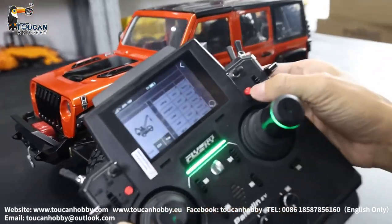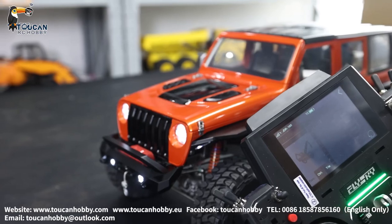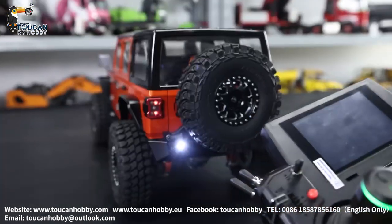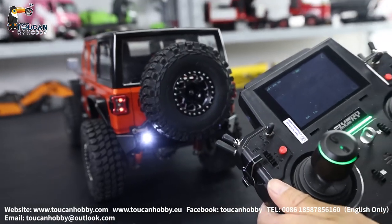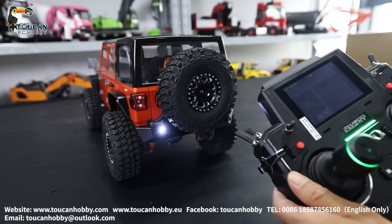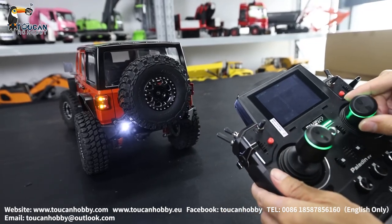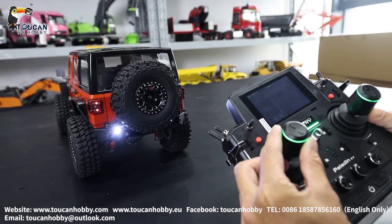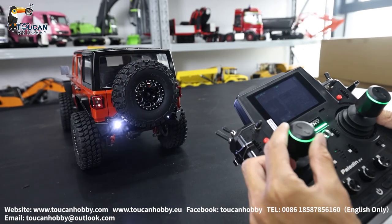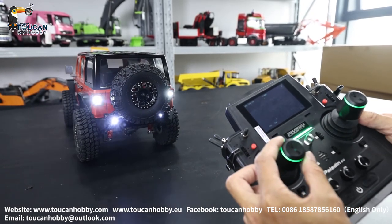Channel 9 — that's the lamp SWC for the light. Push and release — all the lights are on, and turning signal lights. If you push SWC and hold it, it will be warning lights flashing. Release it — it will be normal light. Turning left, turning right, driving forward. Brake — that's the braking light. And reverse — reverse light.